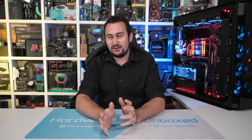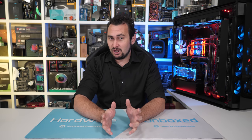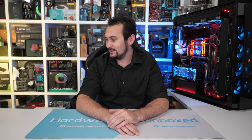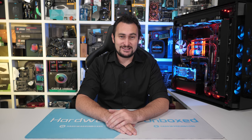And that is going to do it for this video. Hope you guys enjoyed my all-ASUS build challenge. Yeah, it turned out a bit better than I thought it was going to. I thought we had a real mismatch of components, but the 9600K with the GTX 1660 Ti — that's not a bad combo. You could go with an RTX 2060, RTX 2070, or even an RTX 2080 with that CPU and get pretty good performance. It's probably not my first pick for a CPU though — I'd probably rather save a bit of money and get something like the Ryzen 5 2600X, which has 12 threads so it may age a little better. Enjoyed the build — it was a lot of fun and it's certainly a really good gaming system. Not really a build guide either, because I wouldn't use that power supply and a few other things.